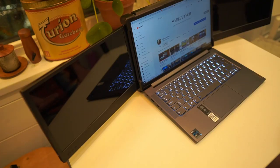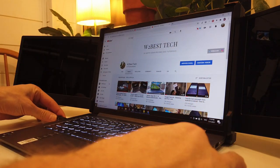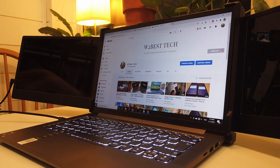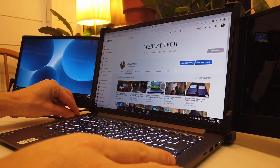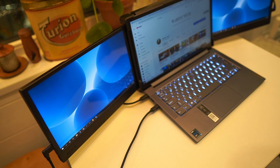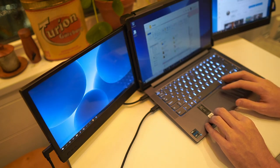In this case I'm using a 14-inch laptop with two USB-C ports with monitor out, which I would say is the preferred way to use the Tri-Screen from Ophia. You take the two provided USB-C cables and plug the short one into the screen on the same side as the ports, and then the long one goes into the other screen. That is the whole setup process and we now have a triple monitor setup where we can move windows across all three screens.